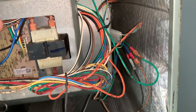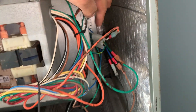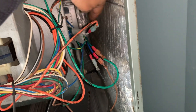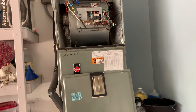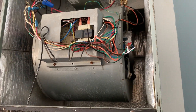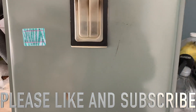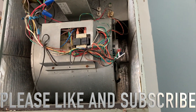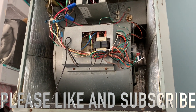I'm going to get some zip ties and wire-tie these wires together. In the future if your air handler isn't working, you can disconnect this whole thing, connect the wires directly, and at least save your motor module. I turned the unit on — air is blowing, so everything is working. I'm going to put the cover back on. Hopefully this video helps you install this ECM, especially if you have a tight space. Please subscribe and like the video — thank you.